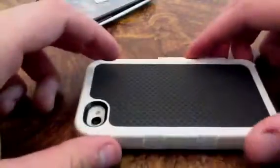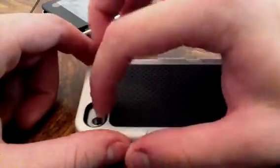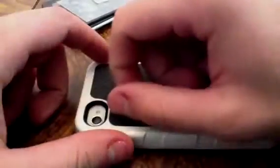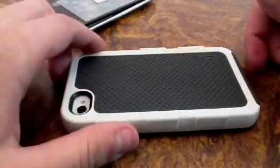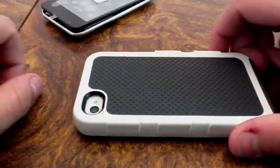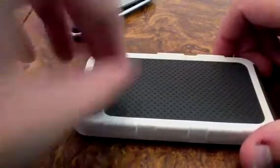With the iPhone 4, what you want to do with it completely disassembled — you do not have to replace the whole digitizer LCD assembly just to test a new one out. You can just leave it set down with everything still connected. Take the plate right here at the top with the five screws in it, take that off, disconnect the LCD and the digitizer. Take your battery, reconnect it — just pop it on there, you don't need to screw anything down. Then take your front assembly for your iPhone 4 and just connect the new ones. You kind of want to fold the old ones back.